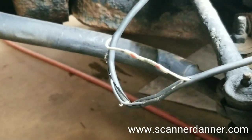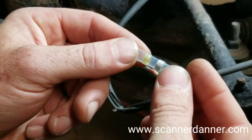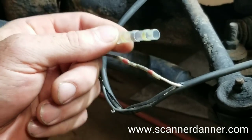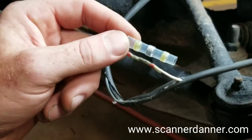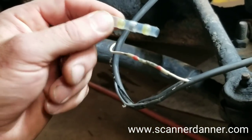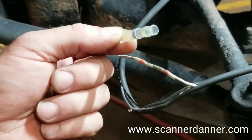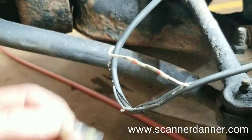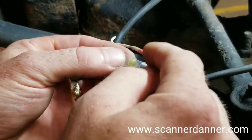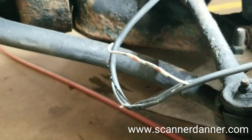When I first used these, I'll show you a bigger one so you can see them. When I first used them, I thought you had to crimp the center part, but you don't. When you look at the procedure the manufacturer teaches, they tell you to do it exactly like I just did — no crimping at all. Just twist the wires together, use the lighter. This is a low temperature solder and it melts down through it. Caleb and I even cut it apart when we were done and noted how well it melted through the wires — and it melted all the way through.